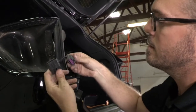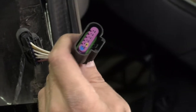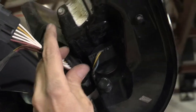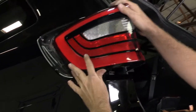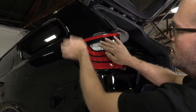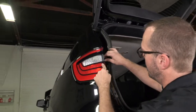Our trailer wiring harness has a pin as well as a slotted connector. We're going to match that pin connector up to our factory tail light harness and use the slotted end to connect back to the tail light. We're going to push these connections together until you hear them click. Then we simply replace our tail light, again aligning our clips by pushing them firmly back into place, and reinstalling our two-piece clips here in the shut face of the door.